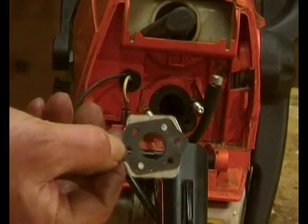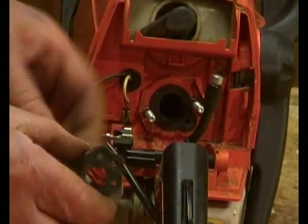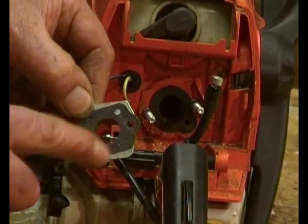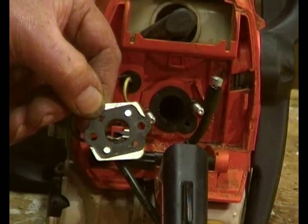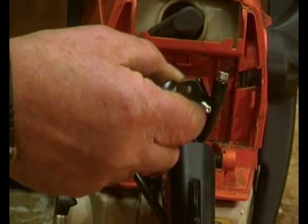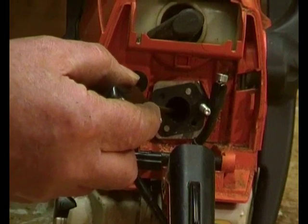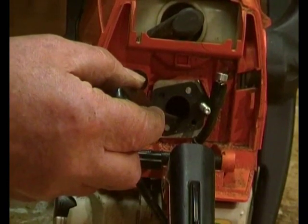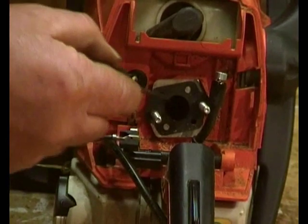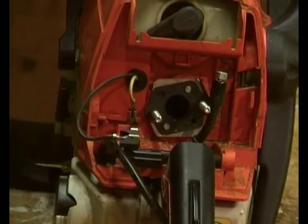The next thing would be this. There's a flange there, and this keeps the rubber venturi open. So it just pops on the screws, and that hole there allows the vacuum through to the carburettor. So the flange itself fits inside the rubber inlet pipe, and when the butterflies in the carburettor are closed, it stops the vacuum created closing up that rubber pipe, just holds it open, and then that hole there is in line with the vacuum.